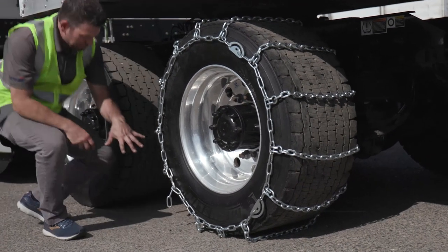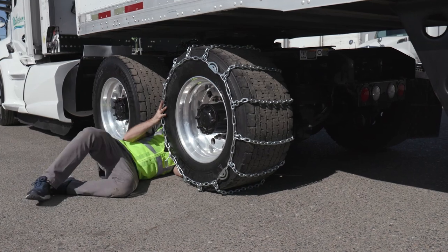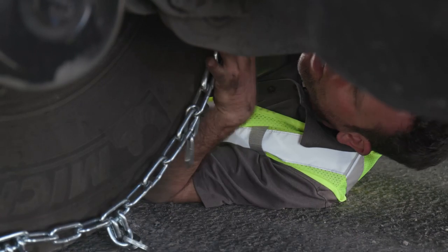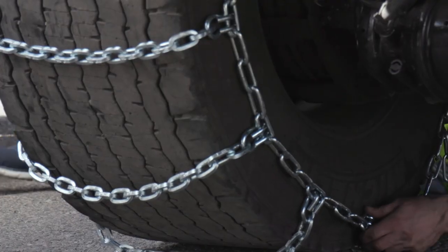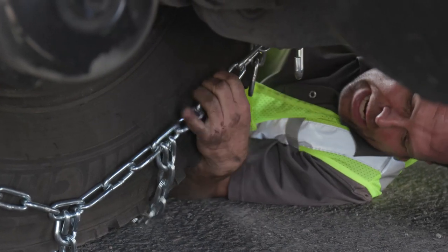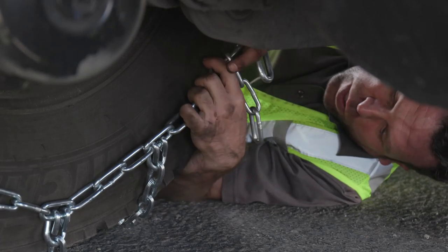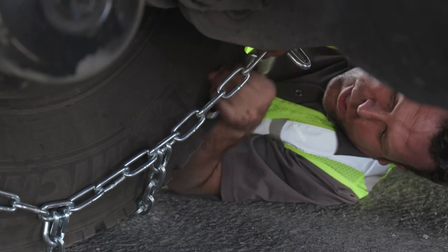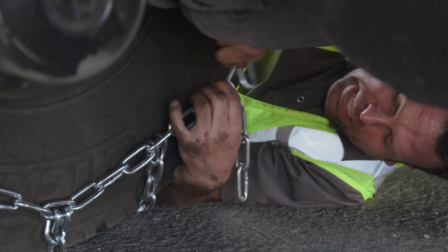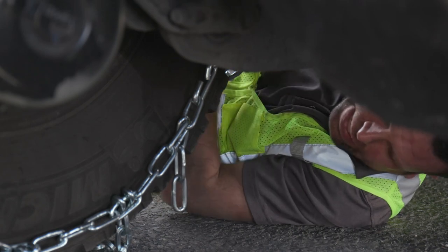After moving the vehicle, we now have a position where we can safely view oncoming traffic and start to tension the chain. From the backside, I'll pull in the excess links by hand. I want to visually inspect that the chain is pulled over the tire somewhat evenly and not riding too high. When pulling in the tag chain, I want to avoid twisting it — keeping it uniform and in line with the rest of the chain. Once I've found the link to hand-tension, I drop any excess chain out of the way and take in as much slack as I can.